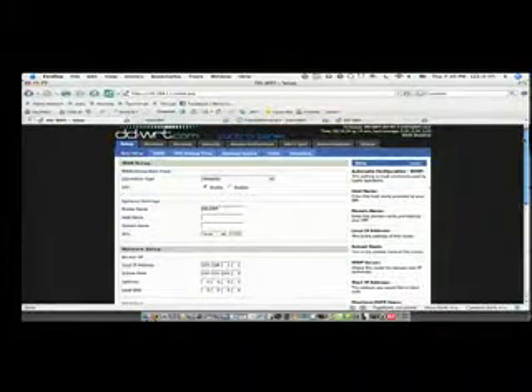Once that's done, you log back into your router, and this is what you get. You get something — I don't know if you can see my screen — that's the admin page for the new firmware. It's announcing: hello, I'm a little different. It's a lot different actually. There's all sorts of features. One key thing I really like is you can disable the WAN port and turn that WAN port into a fifth port on the switch.